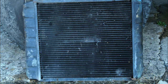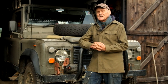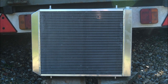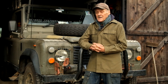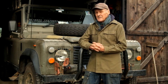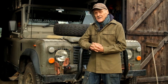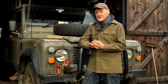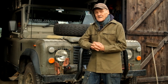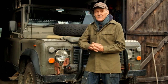The standard Land Rover copper radiator rather struggles with this vehicle, particularly when I go to hotter climates. So a number of years ago I bought an AliSport aluminium radiator, and I also treated the vehicle to the matching intercooler — there's no doubt it gives better cooling. They are absolutely beautifully made, but they are a little bit fragile. A couple of years ago the radiator developed a small leak and I sent it back to the factory for repair, and the copper radiator went back in. I've done a few trips in the meantime and the standard cooling system does struggle. Now I've got the AliSport radiator back fully repaired, it's gone back in and that's where it's going to stay. The engine runs cooler and the cooling fan comes on much less often.